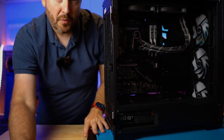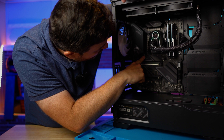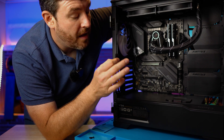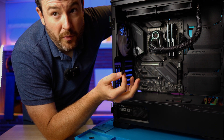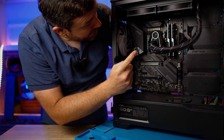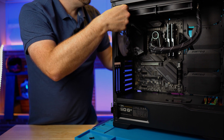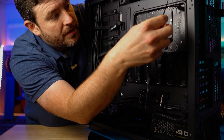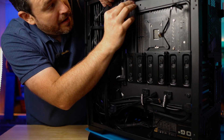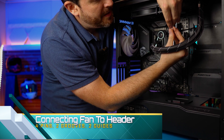That won't work, so now I have to consider these headers over here or go with this fan header right there. This is all part of cable management — I just want to make sure my cables are properly tucked away, not visible. It's an aesthetic thing. This fan has a slot right here and a slot over here. I believe I can route this cable, have it ready to connect over here, and that should give me a good clean front appearance. You can see I have two cables now stuck through — this is going to help me clean up the inside appearance. I can run this cable along this channel up here and plug it in to the actual motherboard.